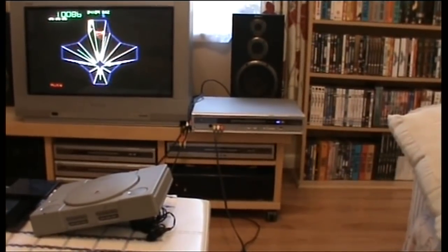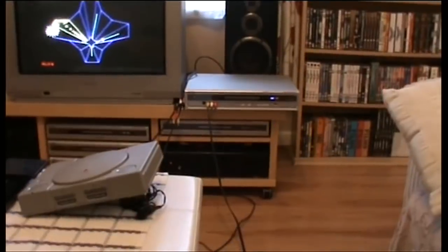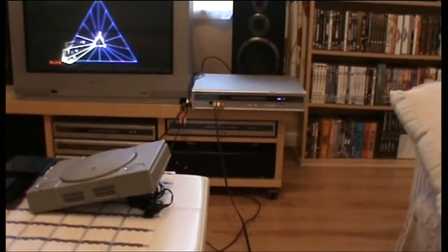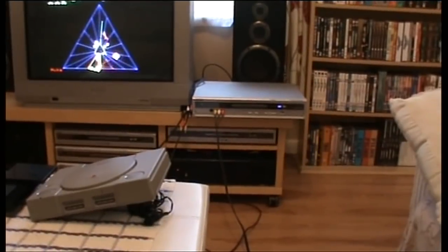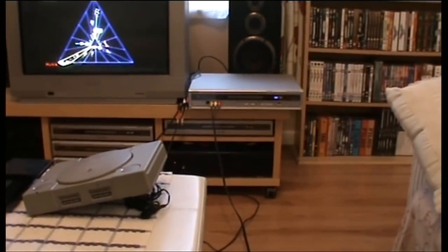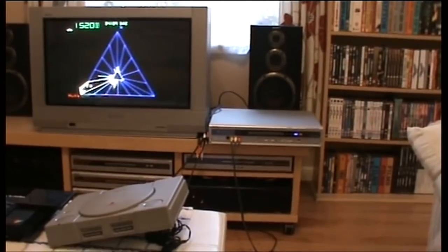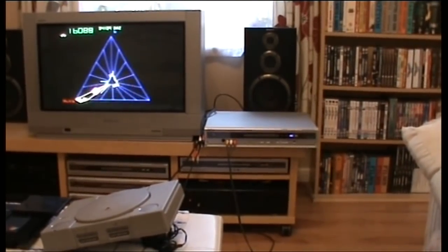My tip: do your research and don't cheap out. Don't pick up something for 20 quid — you need to spend more. These machines cost 500 to 650 pounds new, but I got three of them between 50 and 90 pounds as new old stock. Check eBay. The models you want are the Sony RDR HXD 710 or 910. If you want to record NTSC and PAL60 games — usually foreign PS1 games — you need the RDR HXD 870. That will cover all grounds and you're guaranteed to get recordings like mine. Hope that helps — Zeus out.